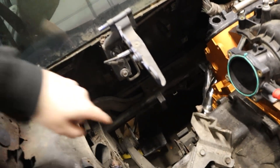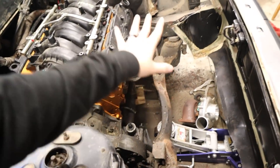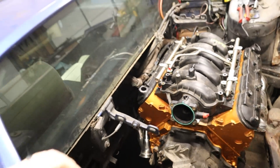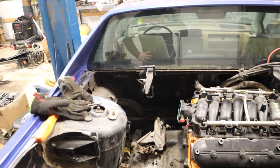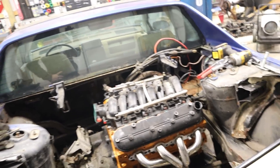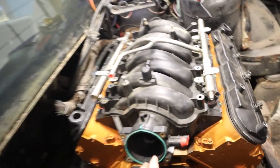All right, got the cradle up into position, got the front bolts in — well, that one's a screwdriver — but I got this jacked up so it's actually on the frame, so this is where it's going to sit. You can see I got the stock LS4 intake back on because it, coincidentally, does clear. Weird, huh? And conveniently, it's angled up a little bit — should clear that stuff just fine, almost like it was designed to have a transmission right there. So I think for now I might just run this intake. It's going to kill a lot of power because the throttle opening on these is really, really dinky — you can see how much it necks it down. At least for the time being I'll run this intake and then upgrade it eventually. We're just trying to maximize what we actually have laying around so we can get things together.